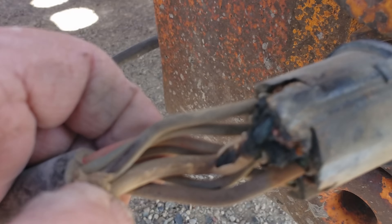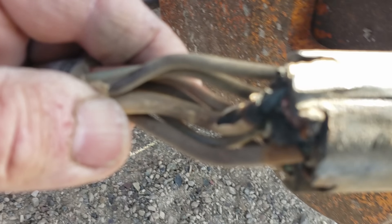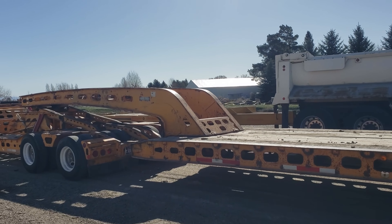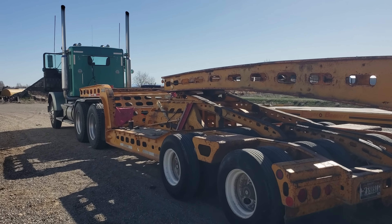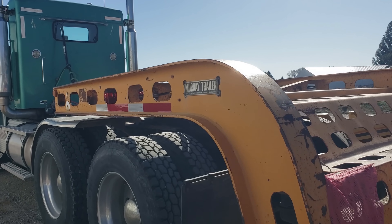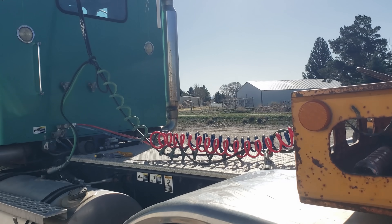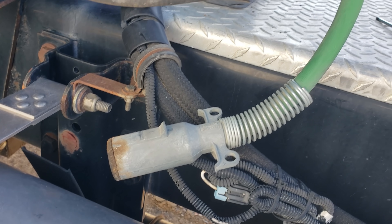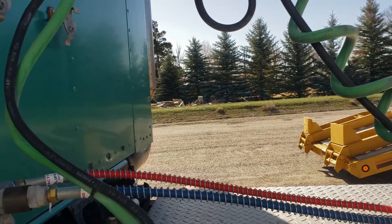I think I found my problem here — that thing is fried. So I'm back at it Sunday morning chasing electrical gremlins. I've figured out my problem: I don't have a ground until I get to the truck plug-in, so my problem is either there or in that end. I'm going to clean all these up, plug it back in, and I may have to take these apart one at a time to see what's going on.